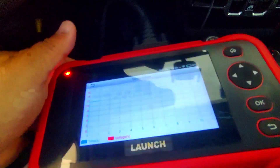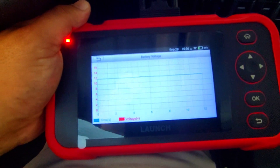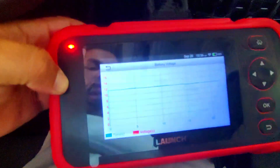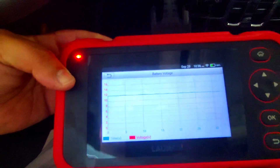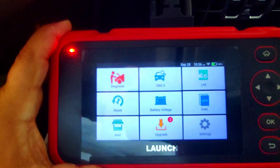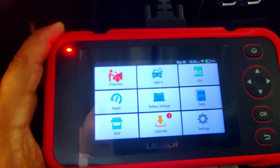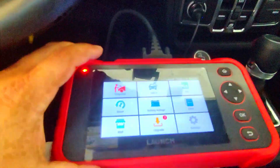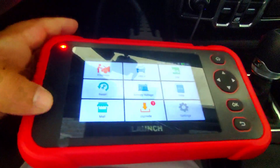There's also a battery voltage function, which is helpful if you're having trouble starting a vehicle. If the voltage is dropping into the lower eights or sixes, you need at least 9.6 to 10 volts to get the motor started. This tool can graph that out for you. If your voltage drops below 12 volts, I always recommend charging the battery before you clear or reset codes or do any kind of advanced troubleshooting, as a weak battery will give you all kinds of funky readings.